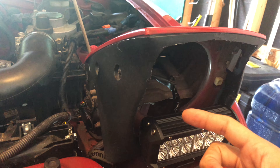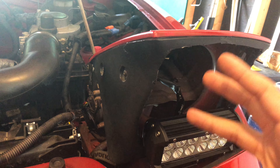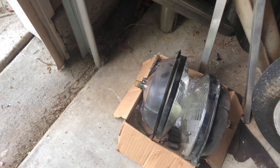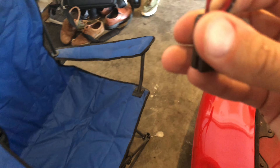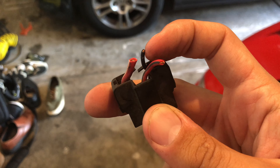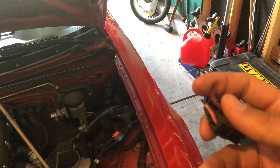These are just for a low beam setting. If you want them for the low beam setting, you have to tie it in — you have three cables back there from your regular plug: a black cable, a red and white, and a red and black. You're going to tie it to the red and black. The red and white is your headlight and the black is your ground. The only ones you're using are the red and black and the black — the red and white you just cap off. You don't have to cut it; you can crimp it so you can go back to your original headlights.